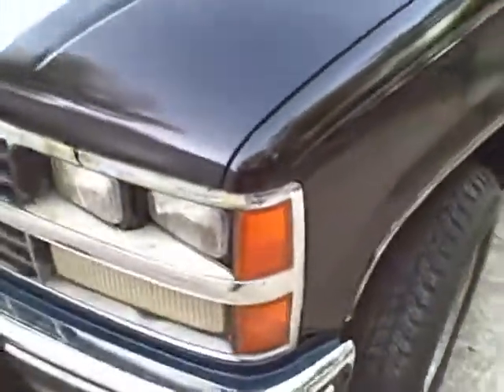I'm thinking about replacing the chrome. You can see where it used to be blue — I haven't painted that strip down through there, it attaches to the chrome front bumper, and I still got to do the grill. You can see right there I didn't take the time to go inside some of these little areas — a little bit of blue showing. If you get up closer you can see where I didn't roll down in here or even lift the hood to spray that. I'll probably come back through when I wet sand it and do some touch up.